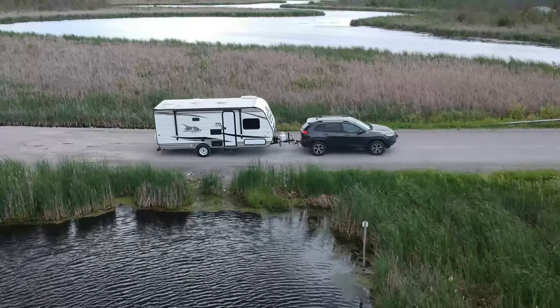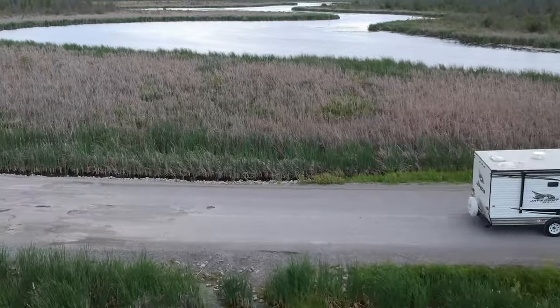Before we move on, let's look at another tow vehicle as an example — our original tow vehicle, the one we used to tow this trailer with originally. Let's use the same trailer and same numbers, but with a different tow vehicle. In this case, it's a 2016 Jeep Cherokee 3.2 liter. When properly equipped, it can tow 4,500 pounds. Knowing the GVWR of the trailer is 3,750 pounds, we should be perfectly fine, right? We have 750 pounds of tow capacity to spare.